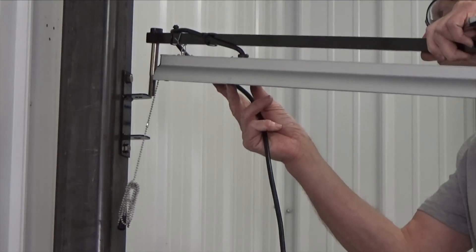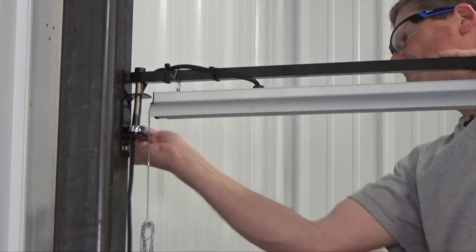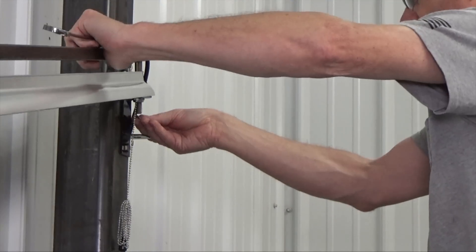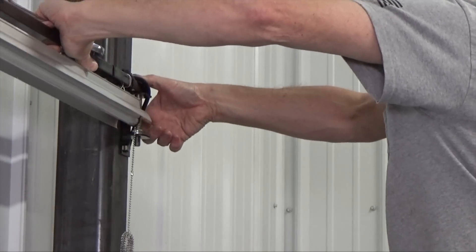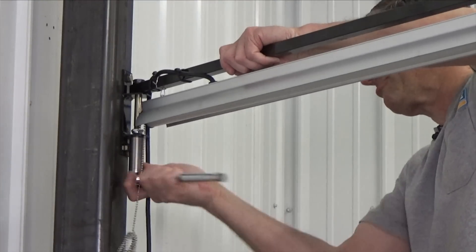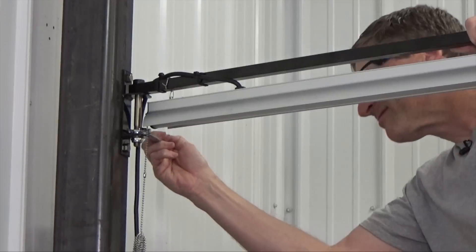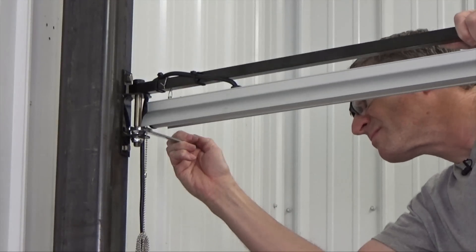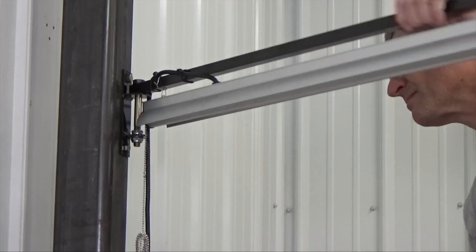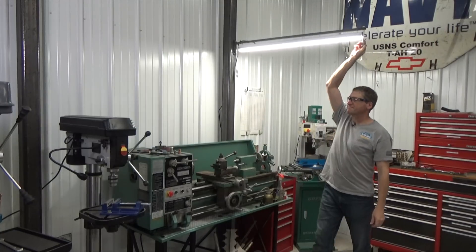To install the light mount, slide the swivel bolt through the top hole. Then run a nylock nut up the bolt far enough so that it won't touch the bottom mount hole, and add a washer. Put the swivel bolt through the bottom hole and secure with another washer and nylock nut. To adjust tension, tighten the upper nylock down to the bottom bracket until it touches it, then snug up the bottom nylock nut to increase the swivel pressure. Much better.